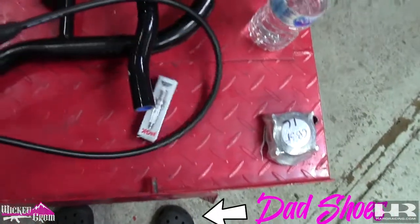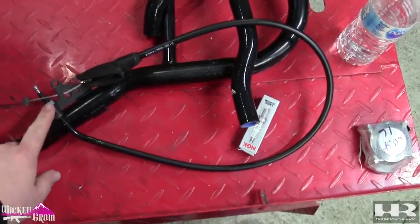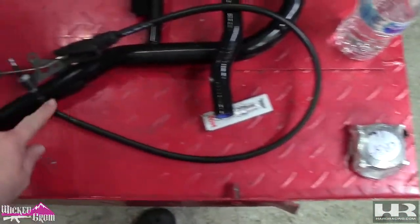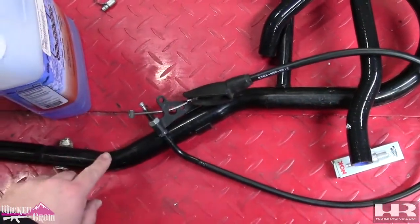I'm going to go over all the parts you need, the parts I use, and I'll have specs, bolt sizes, everything you need linked in the description. So here we go. First thing we're going to use is this clutch cable. This is from Steady Garage. This is a factory Grom cable housing. The actual cable inside is about 2 inches longer.